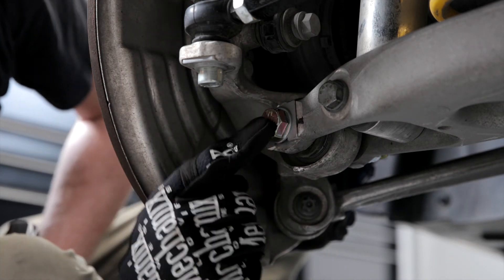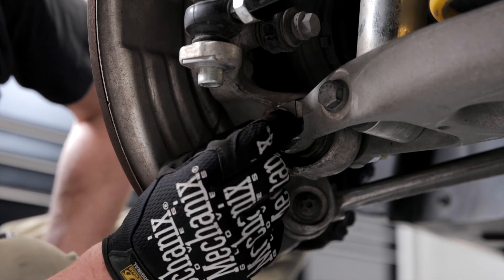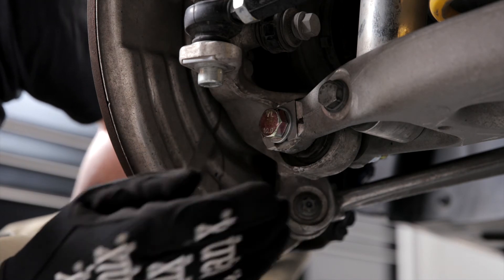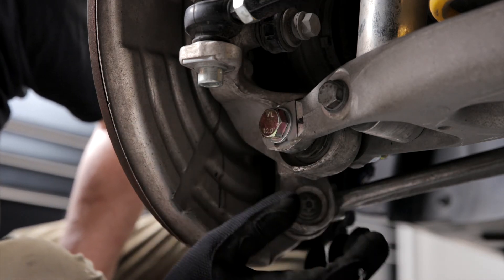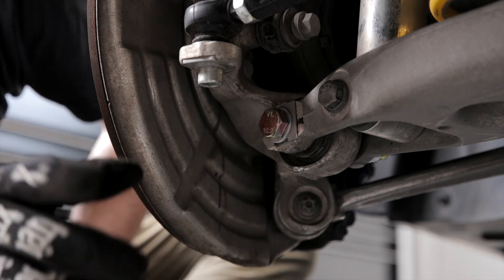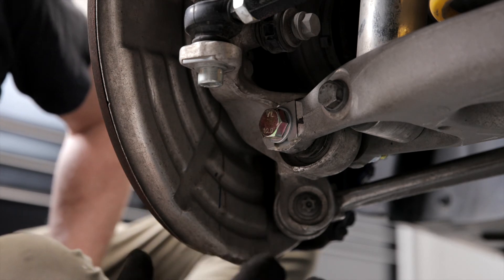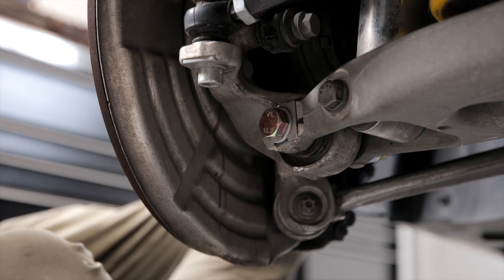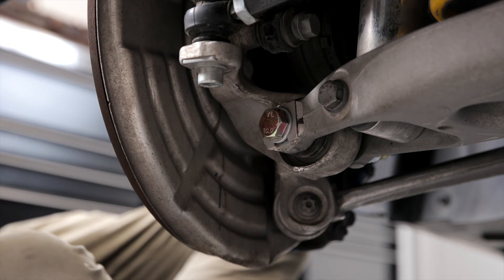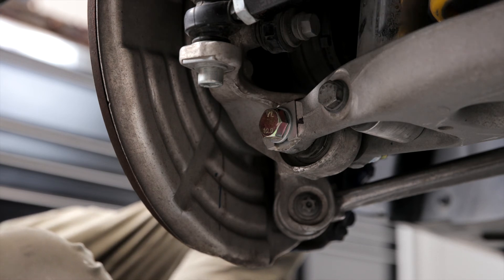Just like that, you've installed your Track Tech camber lockout kit. Now that it's installed, this bolt has zero chance of ever moving. Even if you want to work on your suspension, you put the same shim back in and it will be set to the exact same camber — really nice if you like to pull your suspension apart often, whether you're tracking or trying to dial in your setup. You can pull out shims, put in shims yourself, and that allows a lot of adjustability. You can also adjust your toe with the regular eccentric bolt to make sure your alignment is dialed in, whether through an alignment shop or yourself.